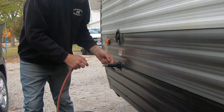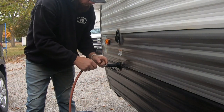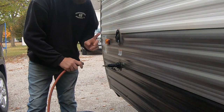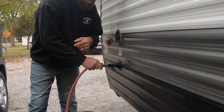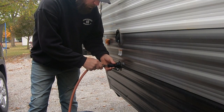I've threaded my coupler on, gave it one more tighten — all the stuff's tight already. We're just going to plug this straight into the camper and it'll fill the lines up. We've got it set to 35 PSI so it shouldn't mess with anything. I think it'll probably hold up to about 60.